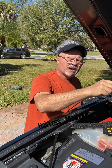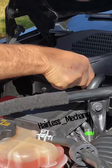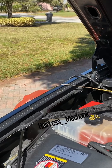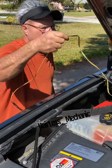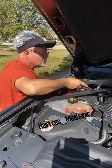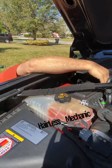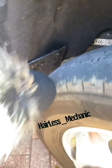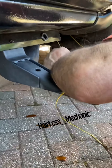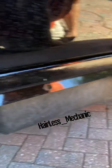I had a string when I pulled those old crappy lights out, so hopefully it'll be even easier to trace this — and it worked. Here's the firewall, put it down here, the wire loom. Now I have it all the way here to this point, which I'm going to wire tie up here. Then I have another loom that I'm going to run the rest of the wire through and show you how I connect the lights.